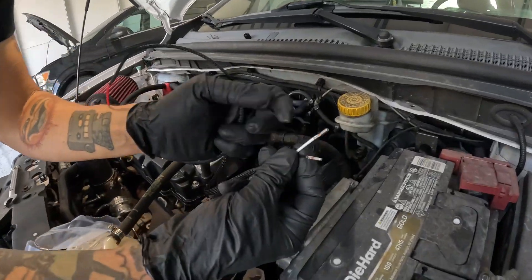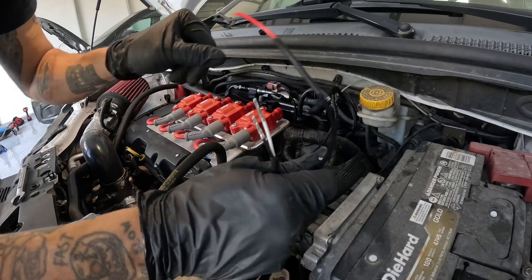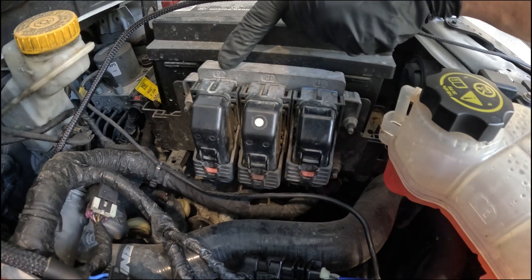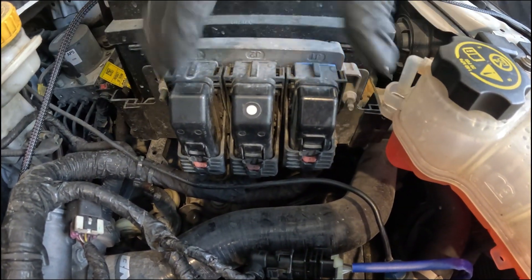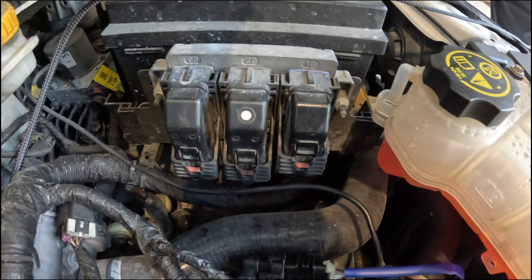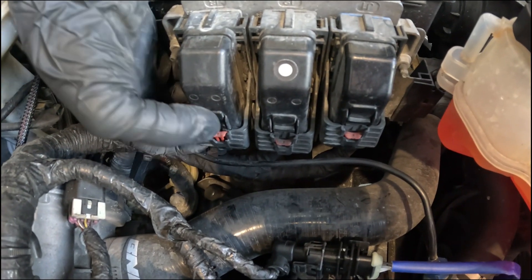The white and the black wires are going to run to your ECM, and the red one is going to run to your fuse box. We're going to disconnect the gray connection off the ECM, which is J3 — you can tell because this one is gray, this one is black, and this one is blue. On a Gen 1 Sonic, the orientation of the ECM will be sideways, so it will be the one pointing towards the back of the vehicle.